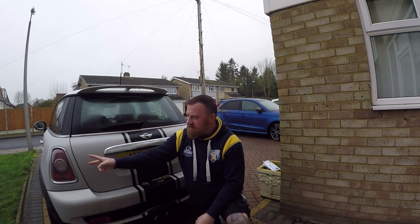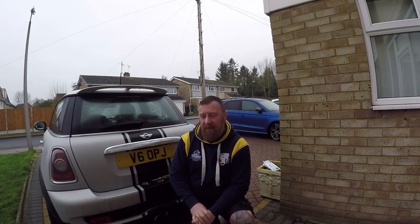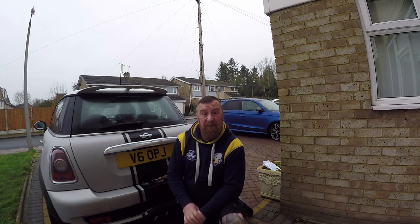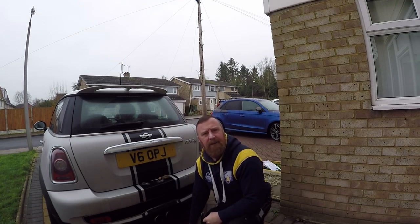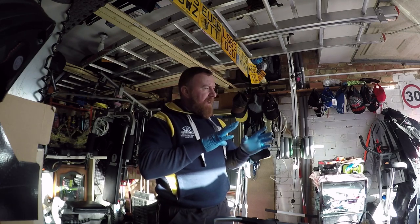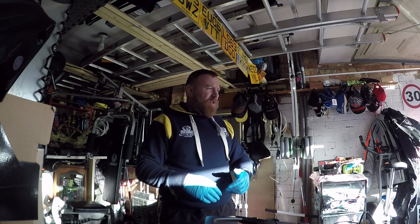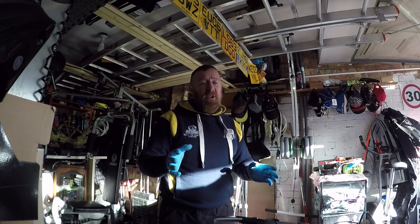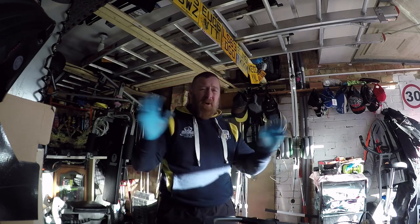To me, looking at the side lights as well, I can see if I can upgrade them to LED and keep upgrading. You can buy kits nowadays. It's just a lot better — you're not using five watts, you're using one watt, so you're not using as much power. Not that a car really has to worry about that as much as a motorbike maybe. Different place on different cars — BMW 1 Series is similar, a lot of BMWs are under the wheel arch, Fords you're just going to have to yank them out. But that's minimal money for the best look, to be honest. Change yours for LEDs or 30% wattage bulbs and the whole car transforms and looks a lot more modern. That's my top tip anyway. There's the bike, there's the car — short video. Check out my videos on my channel, there's loads of helpful advice. Ta-da guys.